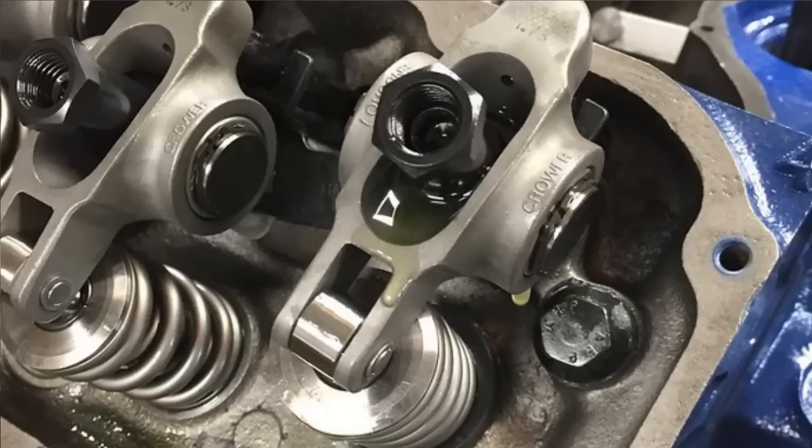The intake was a strip dominator, untouched, and then I had Scott Perkins of SP Carburetors build me a custom Holley Dominator. And it started life as a 1050 CFM Dominator. Lots of tricks inside that carburetor. We knocked the CFM down a little bit, but picked up some good stuff. And yeah, that's pretty much it.